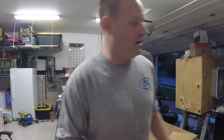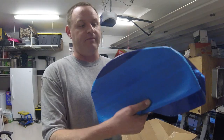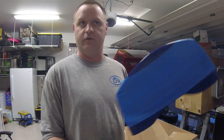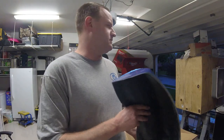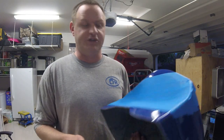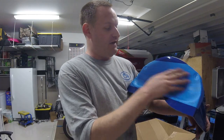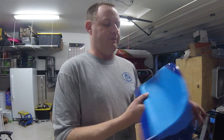I'm focusing on mounting the gauges and the gauge pod. The gauge pod is part of the bodywork - it's the third or fourth piece. The hood, nose cone, and this are the only painted pieces, so you get one shot at it. I've taken blue tape and masked off the entire face. I'm going to be using the stock Miata cluster for the in-front-of-steering-wheel gauges: tachometer, speedometer, fuel, and dummy oil pressure and water temp.